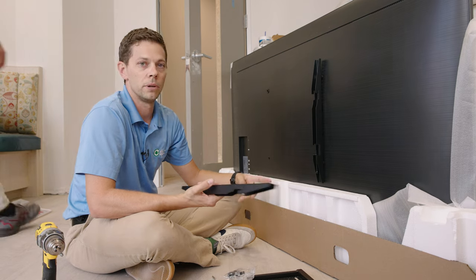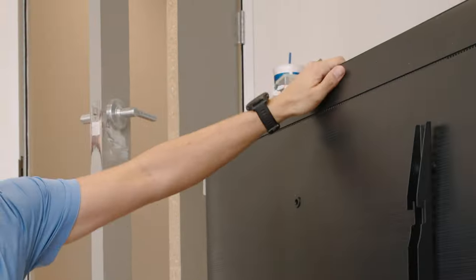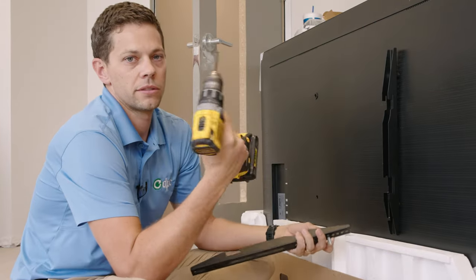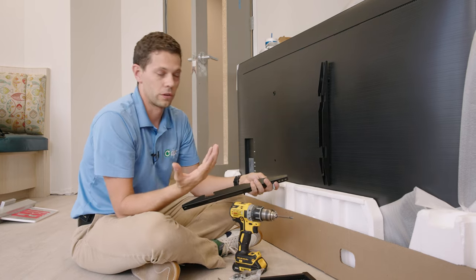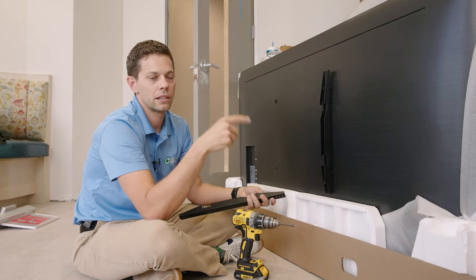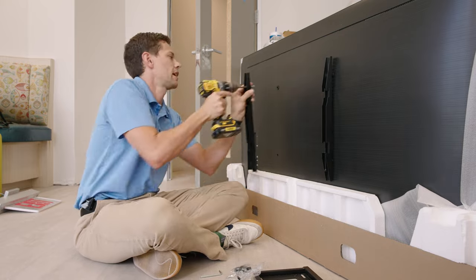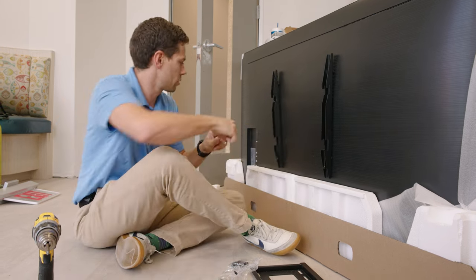I like dealing with the TV while it's standing up in the box, supported by the styrofoam base, leaned against a wall or something soft in case it gets bumped. I went ahead and put the spacers on the back of this bracket too. If you're using a drill, be very careful not to cross-thread the screws. Also don't over-tighten — the recessed nuts inside the TV are probably just press-fit into a board, and if you over-tighten, you'll pop them out and they'll start free-spinning. I use a DeWalt set to clutch setting eight, which I know won't be too tight.